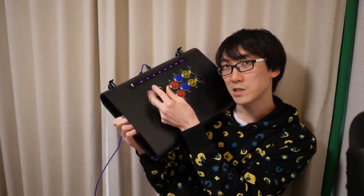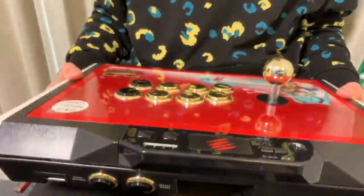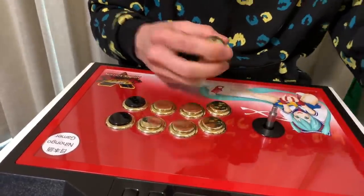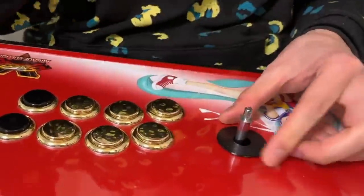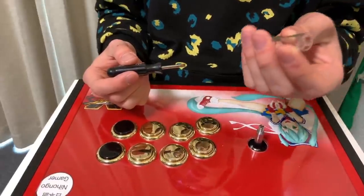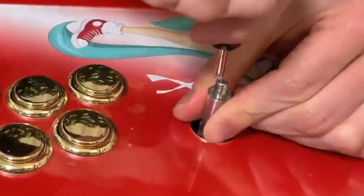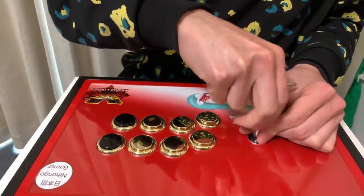Because the Victrix sleeve does rotate freely — I can spin this around and have the ball top not spin around. And one of the coolest things is that I can still use any colour of ball top I want. Just by grabbing onto the sleeve, I can hold it in place and take the ball top off. Just to show how quick that is — I'll just continue to unscrew this. The nut there in the base is rotating with the shaft, and I don't want that to happen. This is why the shaft is really important — because of that rectangular shape on the bottom, you can hold that nut in place while you screw this off with a screwdriver. The Phillips head hole on the top is actually more important so that you can loosen it.